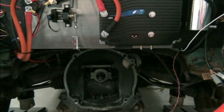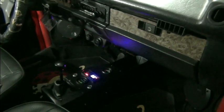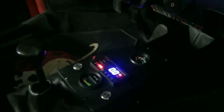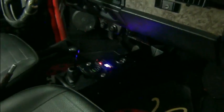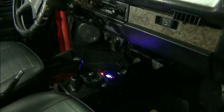Let me show you a little more of the conversion. As we do on all of the Super Beetle conversions, we've added the center console, which holds all our gauges. When we turn on the ignition, you'll see that the green light comes on to let us know that the ignition's on. This right here is our electronic reverse, which lets us know it's in reverse. That's how we handle the dash, because these dashes don't lend themselves to modifications, so we add the console.